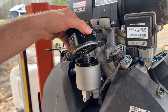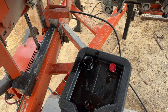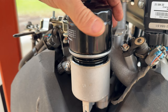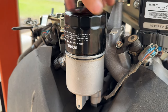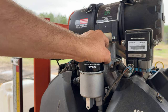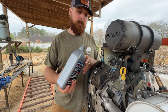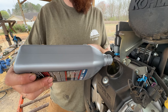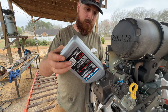There she be. Put that drain into there. Put a little fresh oil around the seal — just a little. Tightening — that should be good. Going for the old no-funnel approach; let's see if we can get it in there without spilling. They've got it at a really nice angle here so usually you can. Pretty open — go ahead and set the neck over in there a little bit and you won't spill a drop.